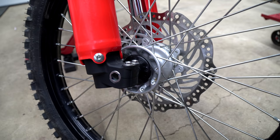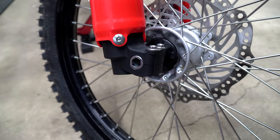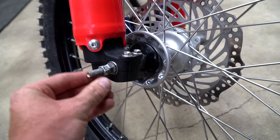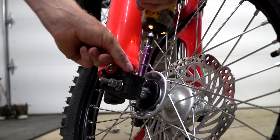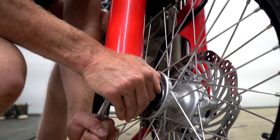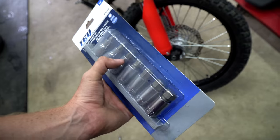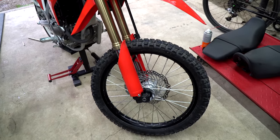I've got a little trick for the front axle since Honda doesn't include a 14mm Allen in the tool kit — just use a bolt with two nuts on it, it fits perfect, and break it loose that way. But scratch that, I broke the bolt. So I ended up spending $40 on a kit because I couldn't find a single 14mm Allen. Honda, what the hell — they should have included one in the tool kit. Very disappointing.